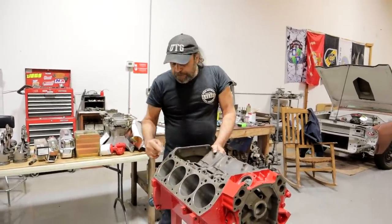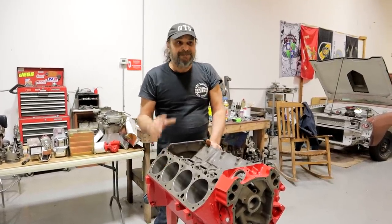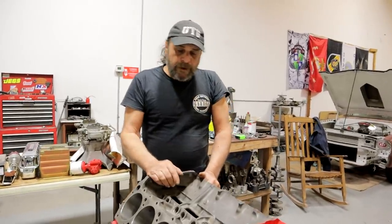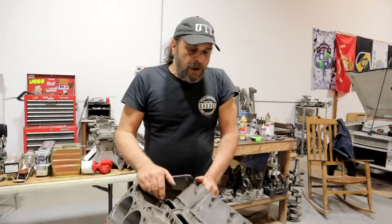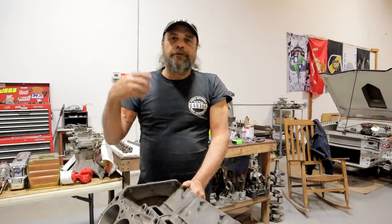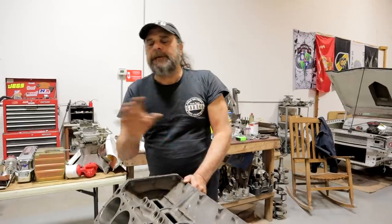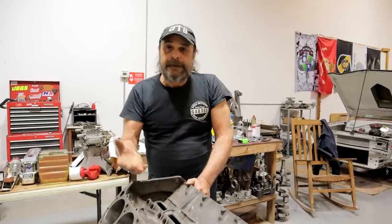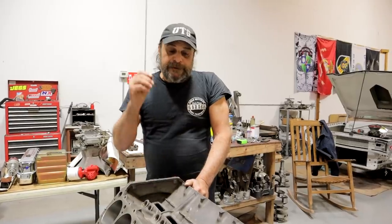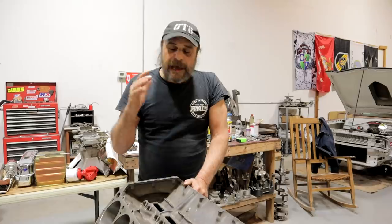You could square the block, but there really isn't enough of a difference — four or five thousandths on the deck is actually less than typical for an assembly line motor, so this is good to go. But the blueprinting process — this whole bit of pre-assembling, pre-measuring, and hand-fitting components — is extremely time-consuming and very tedious, because you're going through the same procedure over and over again. But to gain maximum results, stuff that will either live or give you the most power, it's absolutely necessary.